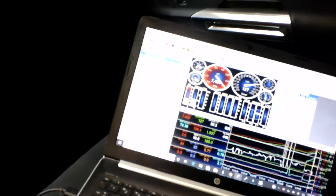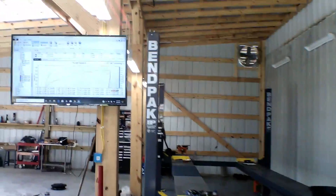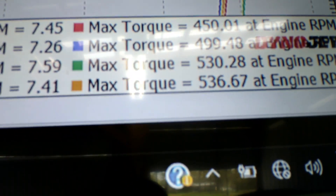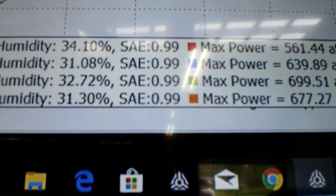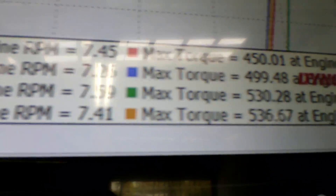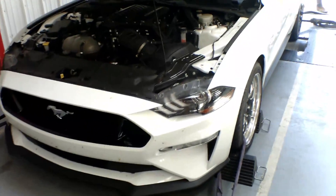Finished the 20 degree pull, but we really didn't give it enough cool-down time. You can see at 7,400 RPM we were getting three degrees of knock retard — it actually pulled timing back to 16 degrees, so it actually lost horsepower in this case. The last pull shows 677 horsepower at 536 pound-feet of torque. The torque is up a little down low because I did add some timing there, but it lost power up top because timing got pulled back. So about 18 degrees is what it likes — right at 700 horsepower.